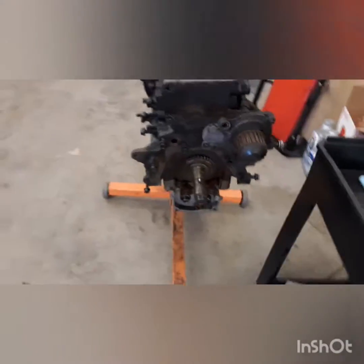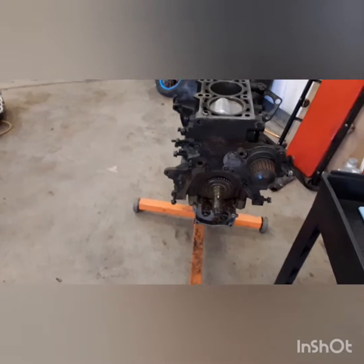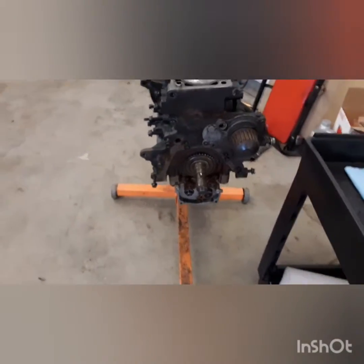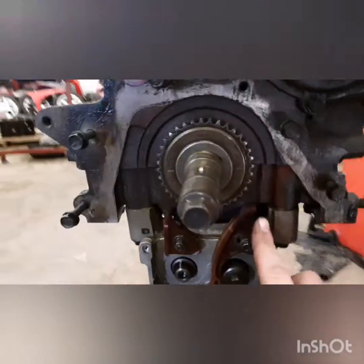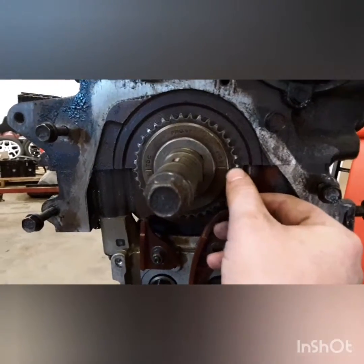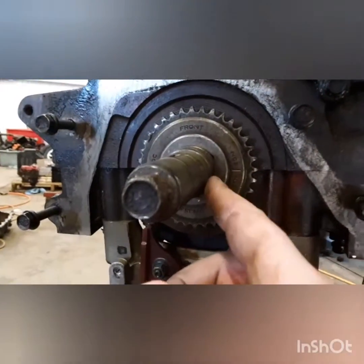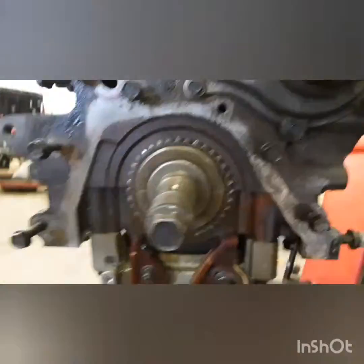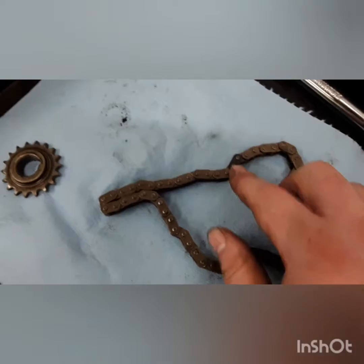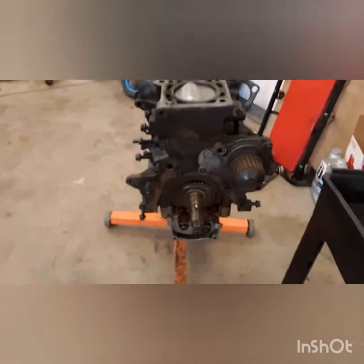In the description I'll include a write-up of how to do it from the forums and the manual, covering the torque sequence and the alignment of the dowel pins and the keyway. On the sprocket you have these timing marks, and where the mating surface between the block and the bed plate is where they line up. There's a flat spot on the crank that faces towards the water pump, cylinder one needs to be at top dead center, and there are different color links on the chain that go on in a certain way — I'll show you how to do that.